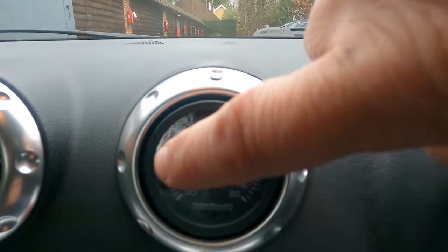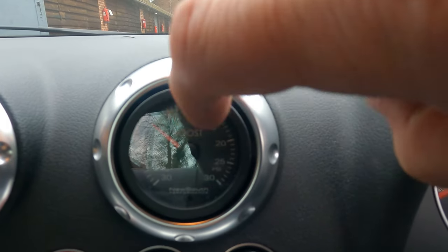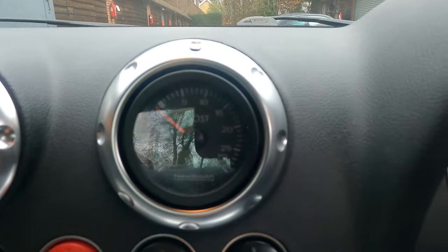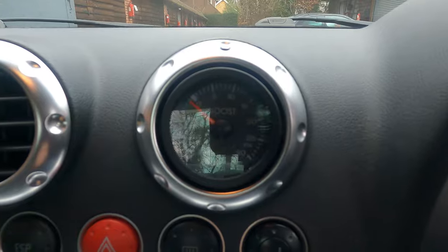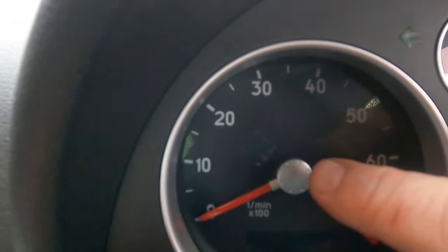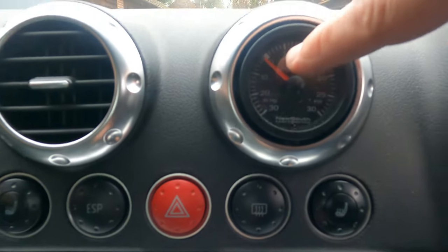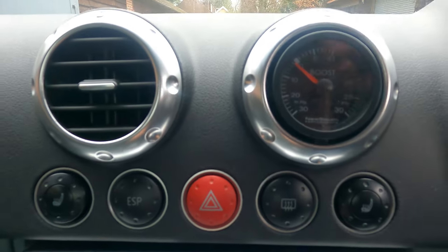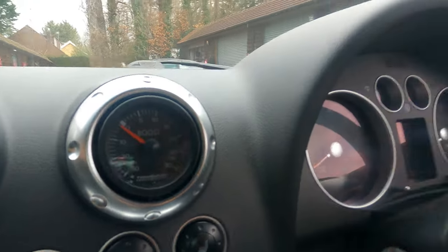So that is the boost gauge all installed, but there are a couple of things I don't like. The needle doesn't sit on zero and that bothers me — it seems to be one psi out on the minus side. I don't really like that. What would have been a nice touch specifically for a TT is if they had the silver bit in the middle of the needle. I know it's one psi out so I might take it up with the company and see what they say — maybe they'll send me another one. Thanks for watching and I'll see you in the next one.